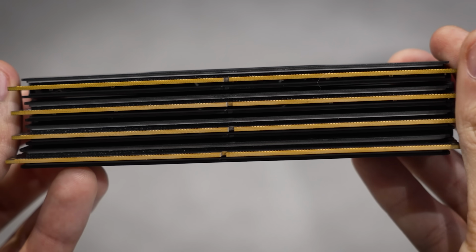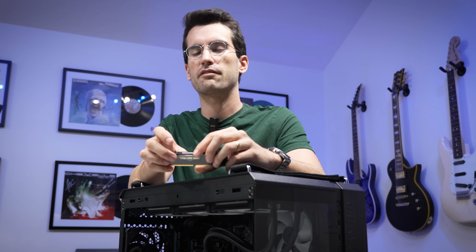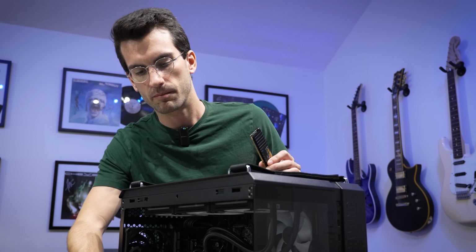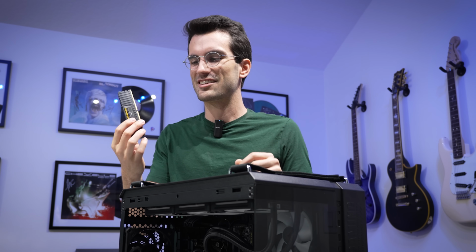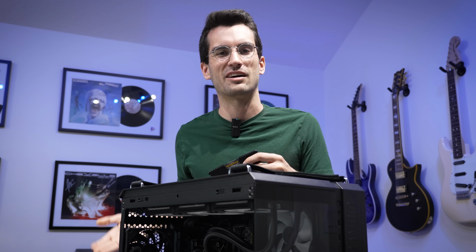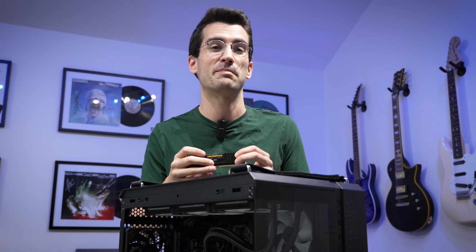With our working DIMM installed, I also hope to be able to roll out a bad BIOS flash if in fact, say, power was cut to the machine during an update. We could have a bricked board, in which case we won't get a post, but we could also not be getting a post from, say, one or more defective DIMMs. This is the problem with having multiple issues running at the same time. We're essentially removing one culprit only for the next culprit to show itself. So with this installed, if we still get no post, it's very likely we have a bad BIOS flash.